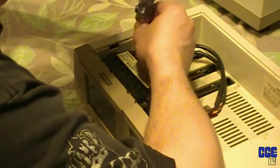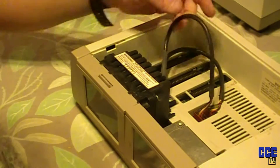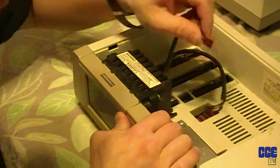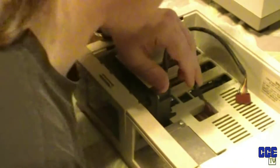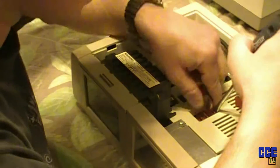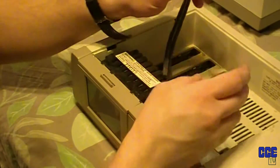This has a little trick to getting it out and I don't remember what it is, because it's been about 20 years since I replaced a drive in one of these. Pull the connectors out — when you pull connectors out, be careful. Try to pull them out by the plastic and not the wires, or else you're going to rip the wires out of the casing. Sometimes you can take a flathead screwdriver and push back that piece of plastic that's holding them in — makes it a little safer.